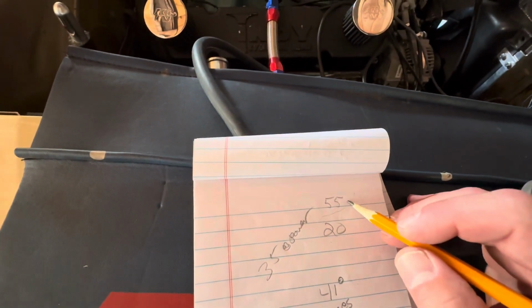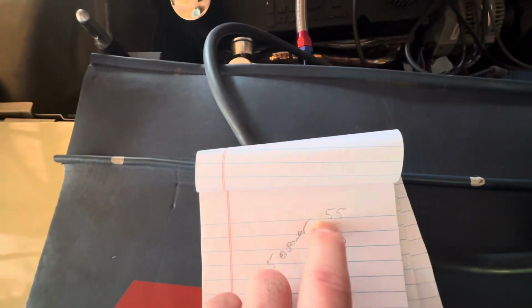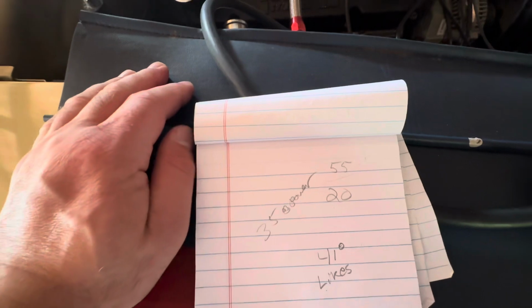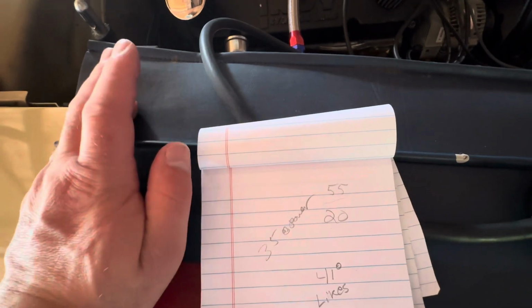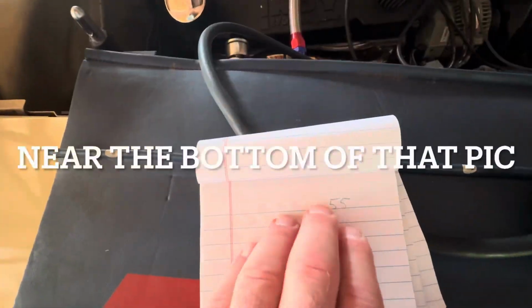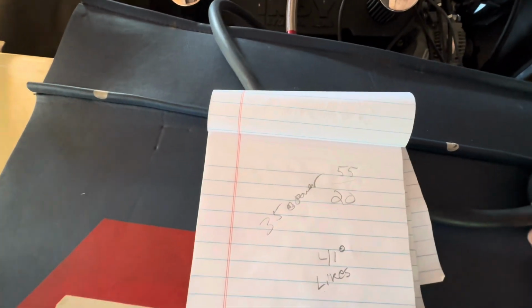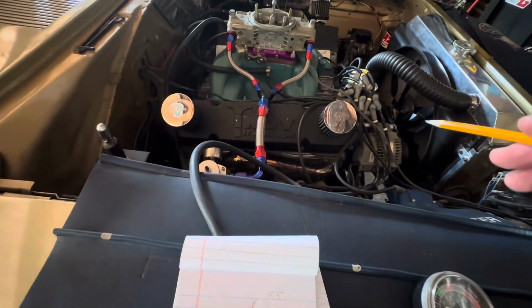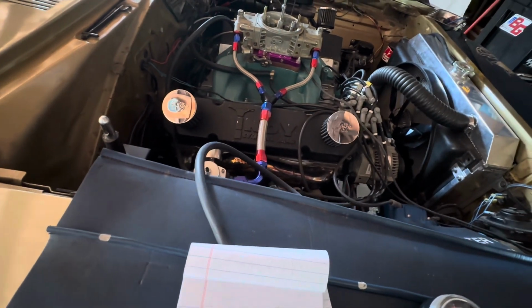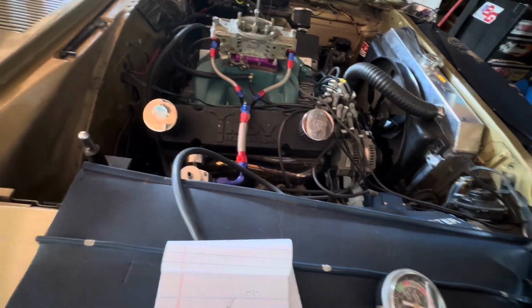Now this 55 degrees is actually kind of important, because if you look back, and maybe I'll insert a picture of the directions from Mopar Performance, not in my book that I was talking about, but there's a Mopar Performance pamphlet somewhere that lists stuff. I'll insert the picture. And it says RB engines maximum of 56 degrees total timing. So that is actually remarkably close to what they were talking about, which seems like a huge amount of timing. But I've seen it on this engine here. While free revving and watching how it goes, it climbed up probably to about, I hit like 53 or 54. My fluid damper stops reading at 50, but I know it was at probably 54, and I backed off. But I didn't hear any detonation.